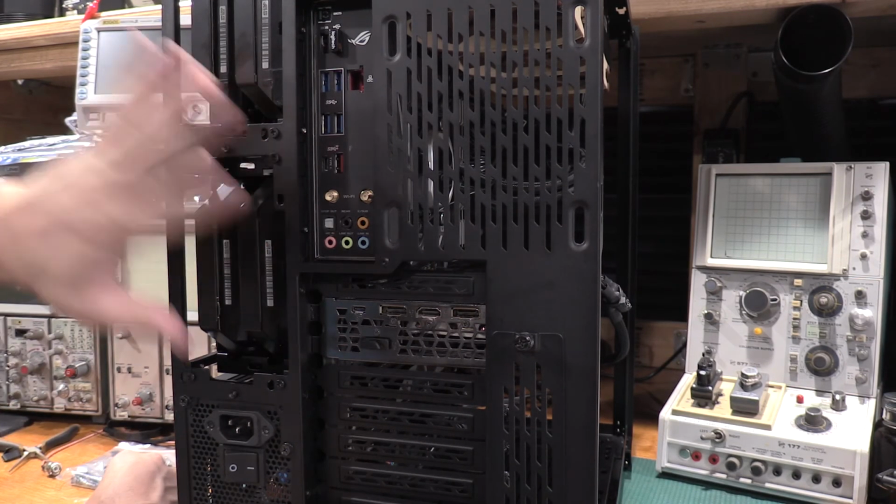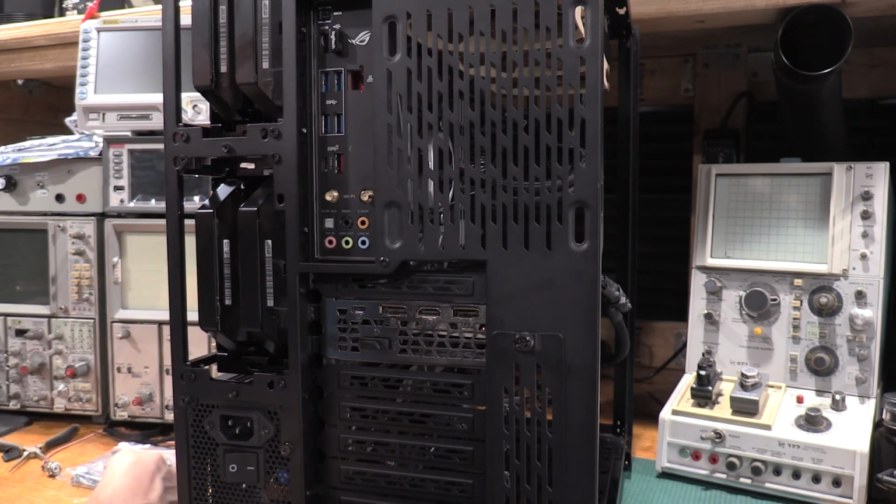Yeah, so now that I got the drive set in, I'll get that frame put back on, and then we'll fire it up and just let the RAID array build. Like I said, that's probably going to take a day. When I formatted my bulk file storage over in the rack, it was a 3-week format. It just took forever to initialize the array and then do the slow format on the drives just to check them all in and make sure they weren't going to have any problems.